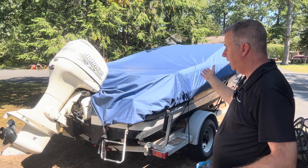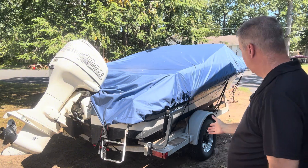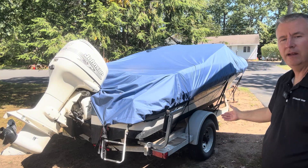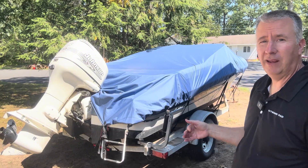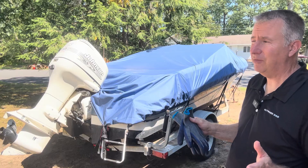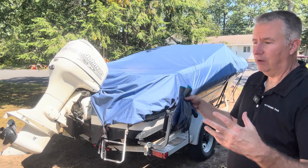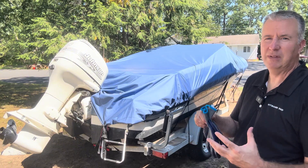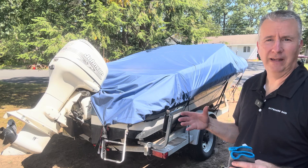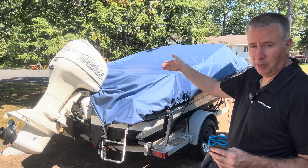At first glance — beautiful boat, nice cover, clean motor. The rest of the fiberglass around the sides looks really clean. The trailer looks really clean and has newer tires on it. The owner said he went through the bearings. The brake system is shuddering on him. Typical brake systems — I never got more than two, maybe three years without having to pull them apart, clean them out, rebuild or re-lube them. They get very corroded from salt water. So there's a lot of maintenance, and you may have to replace parts. That may just be typical maintenance.